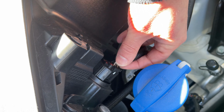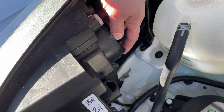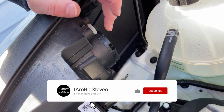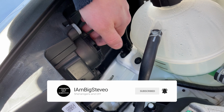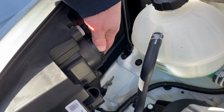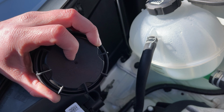Anyways, what we're looking at is this up here. This is the headlight. With HIDs, that raises the question, well, you've got a ballast, igniter, all that stuff that needs to fit inside here when there's not really any space at all. So how do you do that? They make them so that you put a hole in the back of this cover and you run the wire out from here, and it goes in towards the ballast, fires off the igniter, which then in turn comes back into here, which goes to the bulb.